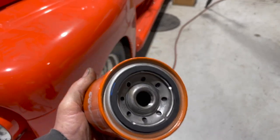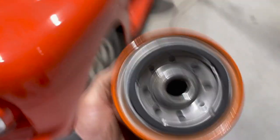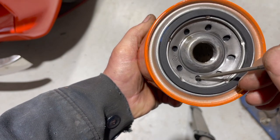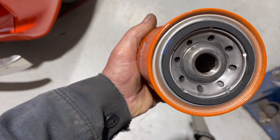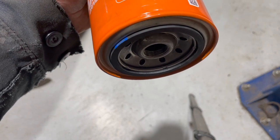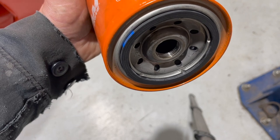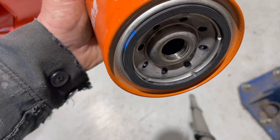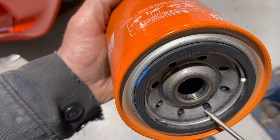This Fram filter has the anti-drain back. It's got a rubber shield, and that keeps the oil from draining back once the engine's shut off. So when it's mounted like that it's probably a good thing, but on the Model A, every valve cover I've ever pulled off, oil ran out — didn't matter if it had been sitting for two or three weeks or a month. So you still had oil in the valve chamber that was feeding the main bearing, so it probably ain't no big deal with this right here.